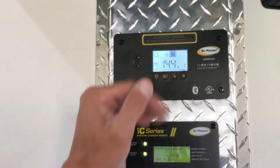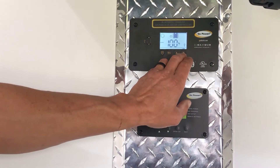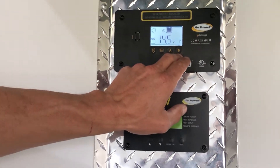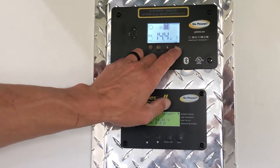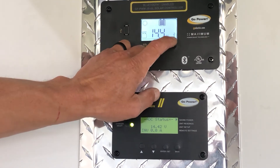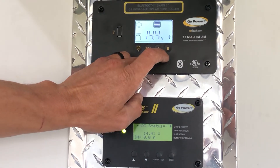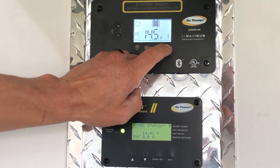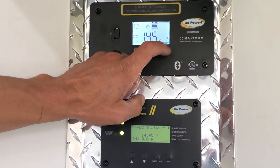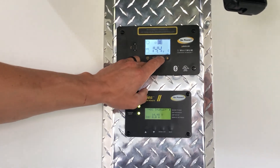So if you just want to see battery voltage, it stays on that screen. The B button cycles through the different screens, but it also allows you to program your battery type. To do that, hold this button down for three seconds. When you see the number one flashing and the battery type flashing, you can tap the button to go through the four different battery types: sealed, AGM, flooded, and lithium. The bottom right corner - LFP stands for lithium iron phosphate - if you have a lithium battery on board, this is the selection you want. Once you find the battery type you want, go ahead and hold the A button down to confirm.